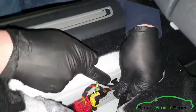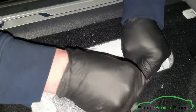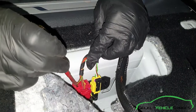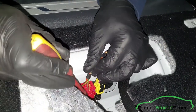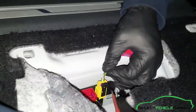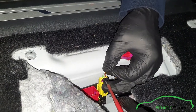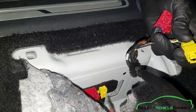There's a cable guide here first which is just secured to the body — pull that out. Then there are two plugs: one is for the seat functions and the yellow one is for the airbag. First the big red one — push the tab in, pull that up. For the airbag plug, this black section just needs to slide out upwards, then you can press on that and remove that plug, and that's the wiring free.